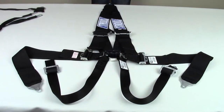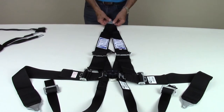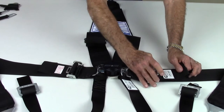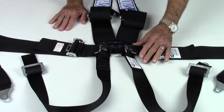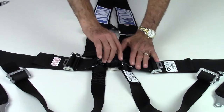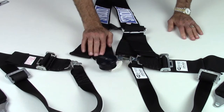This is a Stroud safety six-point cam lock seat belt system. This assembly has V-style shoulder straps. The shoulder strap is one piece that passes through a bolt-in tab at the top, which is mounted to the roll cage four to five inches behind the driver's head. These lap belts feature pull-down adjusters, but cam lock systems can also use pull-up adjusters if required. There are two crotch straps, which makes this a six-point system. The straps pass under each leg and fasten to the chassis with bolt-in tabs. The cam lock releases by twisting the knob in either direction. All straps release except where the cam lock is permanently attached to the right shoulder strap.